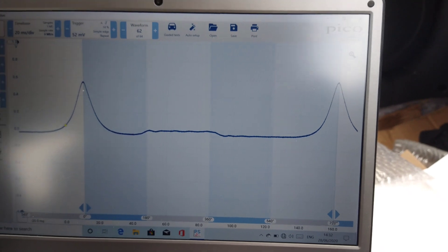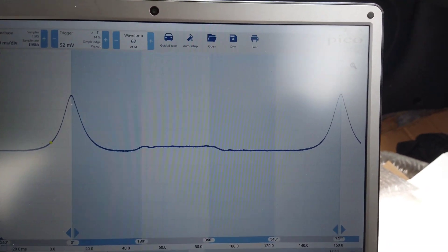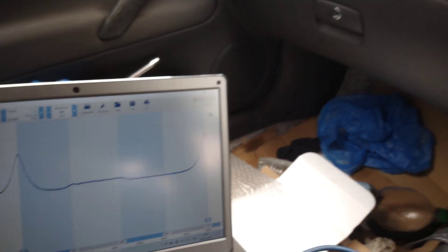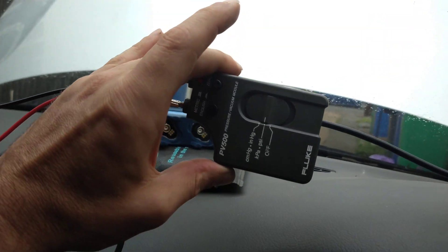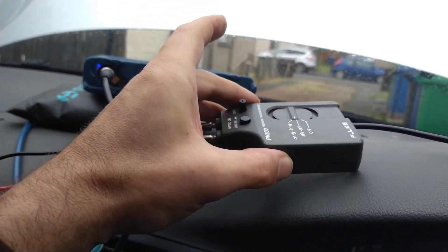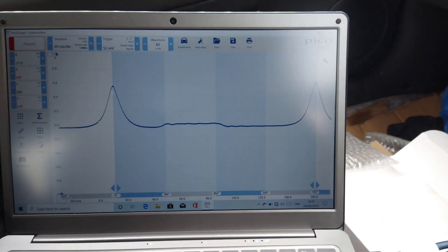I've not got exact measurements out — it's just to show you how much better the waveform is after Dave showed me what to do. It's as simple as pressing a button. I've probably also got the same benefit if I went into centimetres of mercury instead of inches of mercury. I'm passing it on, just showing you it's a bit better than I first thought. If you haven't looked at Dave's latest video with a pressure transducer, go and check it out — it's relatively inexpensive and very good, and does a much better job showing vacuum than cheaper ones. Thanks for watching, I'll see you next time.